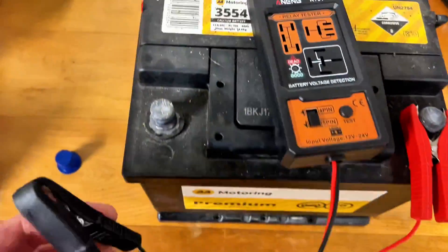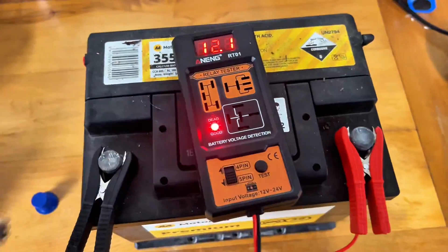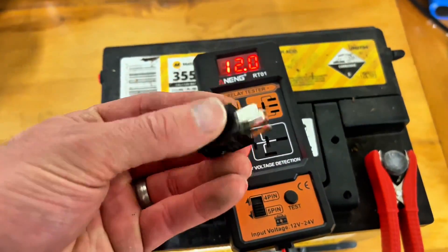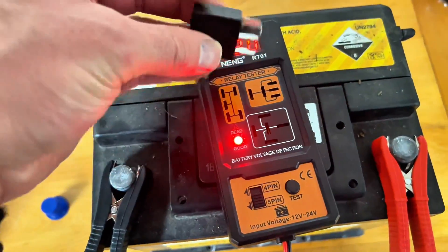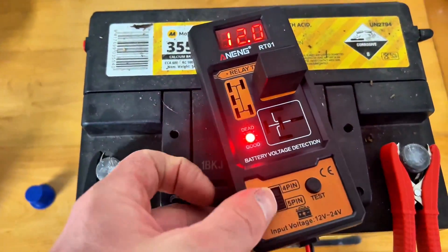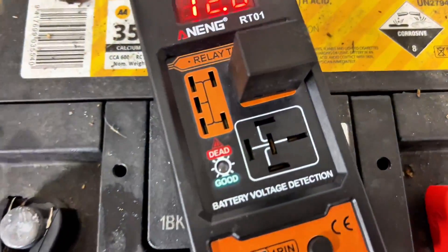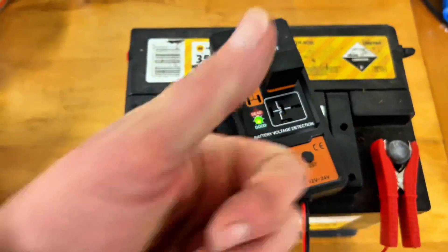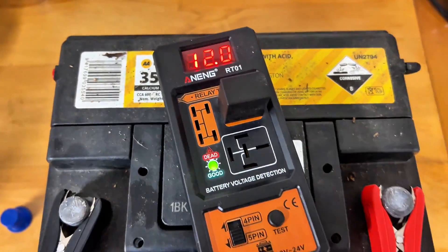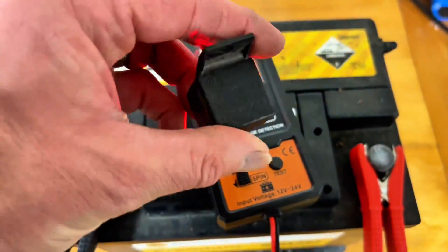It's a little bit harder to test without power, and that's why this device is so handy. You take the device, connect positive to positive on your battery — this can be on your car battery as well — negative to negative. It shows the voltage of the battery. In a real-life scenario, you grab your relay, chuck it in the hole that matches the relay you have, check whether it's four pin or five pin, press the test button, and if it's green and clicking, you know it's functioning correctly.